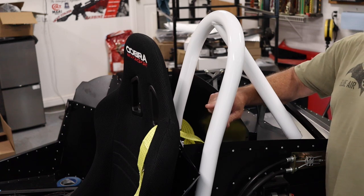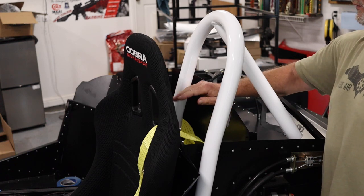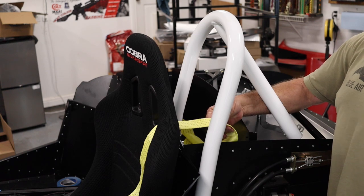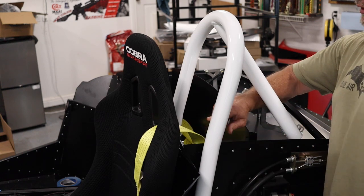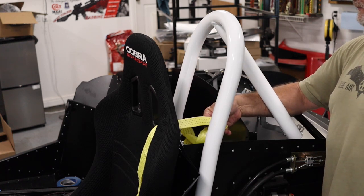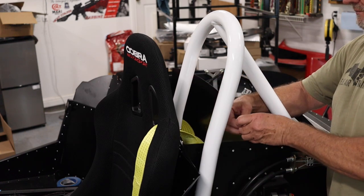In order for this to work, I have a couple of options. There's a company that created something that'll buckle basically to the side of this tube and run a bar straight across to hook your seat belt to, to get the appropriate geometry. I really don't like the way that looks. Another take on that is I could weld a bar from here to here and then hook it up — I kind of like that, it would look pretty good. But again, from the back you're going to see that bar going across.